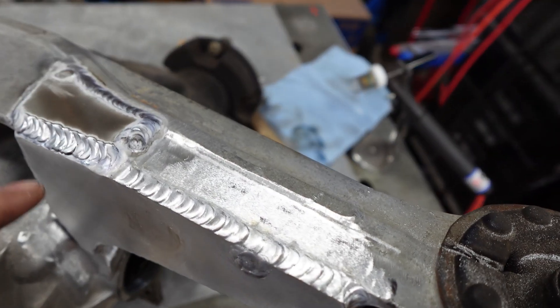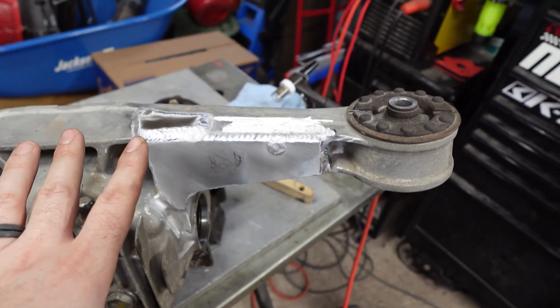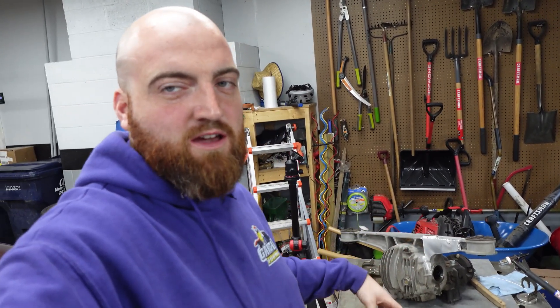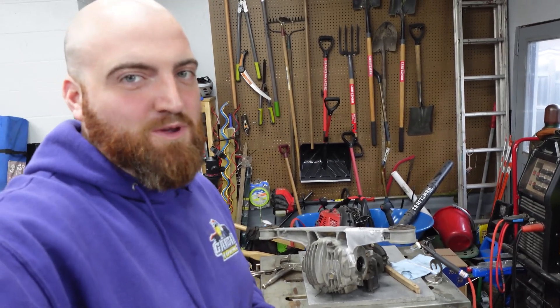There you have it — fully welded around. You can see I did a little weave there. This is now reinforced and ready to go back in the car. I'll slam some axle seals in it, but that's how you reinforce your diff. If you don't have a welder or you're not comfortable welding cast aluminum, I will be putting this service on my site — you can send me your diff housing, just the carrier please, not the whole diff. I can reinforce it, I keep plates in stock, and send it back out typically within a day or two. If you want dual plates on either side I can also do that. That's how and why you reinforce your Miata diff. Thanks for watching and subscribing, I'll see you in the next video.